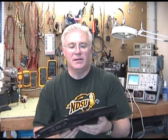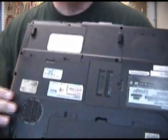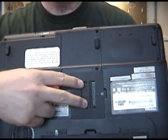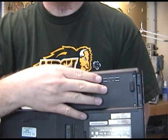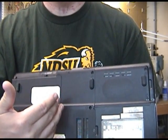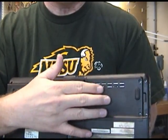It's not too complicated to get into them once you know where the little bits and pieces have to come off. For the most part you have to take the battery out because there are screws under there. You have to take the memory panel off. On most laptops there are screws under there. You have to take the hard drive out because sometimes there are screws under there, and for sure you have to have the hard drive out because it's integrally connected into the motherboard.